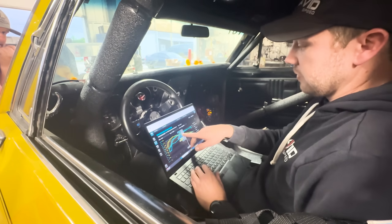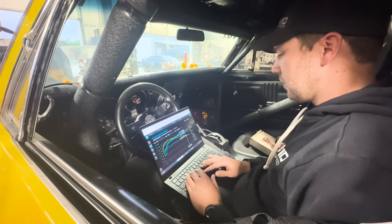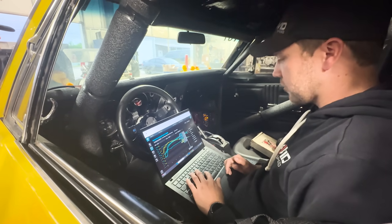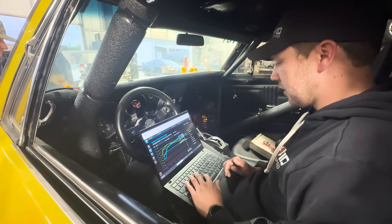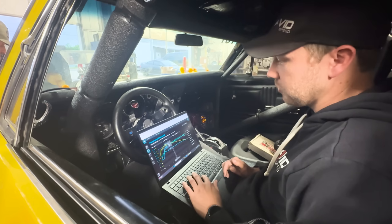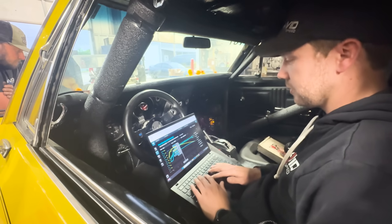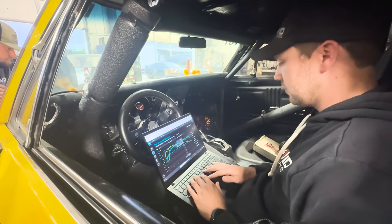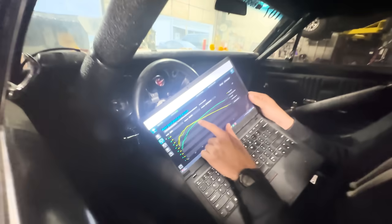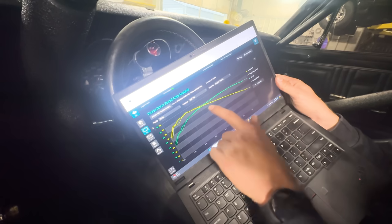And that's still 9 horsepower right there. That we picked up? Yeah, in spots. The peak only picked up just a couple, I think 4, but there's spots that we're seeing. I mean, right there's 10 horsepower. Yeah, we might want to keep going. It might be more than I realize. Let's see, there's 12 right there. So don't look at just the peaks. If you drop everything else out, you can see there's gains throughout. There's constant gain, but it just gets bigger in different spots.